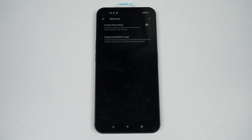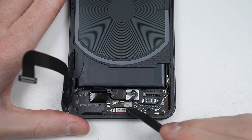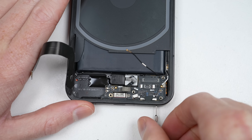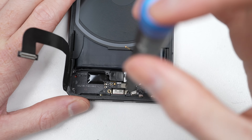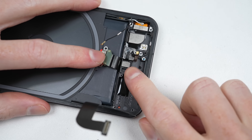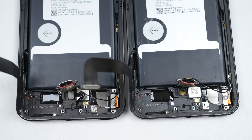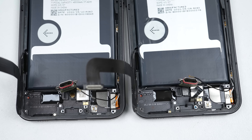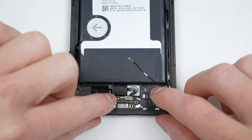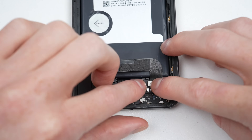I think it's fair to say there currently isn't a way to replace the fingerprint sensor. What if you were to install a new screen — would you also be sacrificing the fingerprint function? I'll swap the sensors between the phones, resulting in the motherboard and fingerprint reader matching while all other parts remain foreign. The optical sensor is located under the USB-C port and comes out easily. I occasionally hear from supporters of anti-repair — their biggest drive seems to be the belief that if you can change the fingerprint reader someone could easily hack your phone. While it could be possible, your pin code is required after a reboot and there's only a set number of attempts, usually around 5, meaning you can't brute force the passcode. A possible workaround is to have a mechanism where the new part is disabled until re-enabled in the OS, kind of like unlocking the bootloader. And if your threat model is really that high, you shouldn't be using fingerprints — stick to a long pin or complex password.